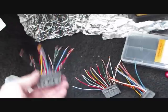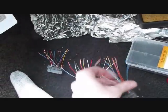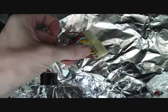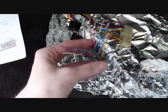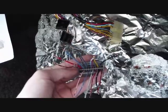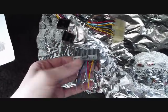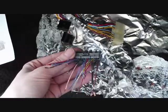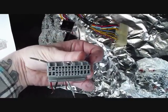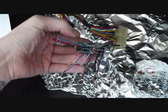The first thing I've done was strip all the wires off of the OBD1 plugs so they're ready to go — I did all three of them. Now, one important thing: you want to make sure that the button you push on the top of the clip is on top, and that whenever you read a pin-out you're always reading it from the back side of the connector, not the front side. If you read it from the front side you're going to swap everything the wrong way.